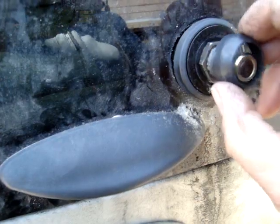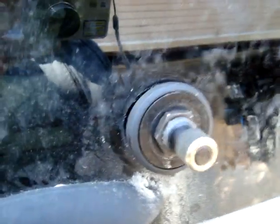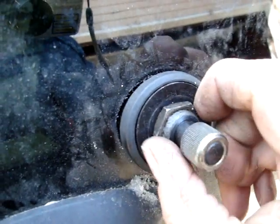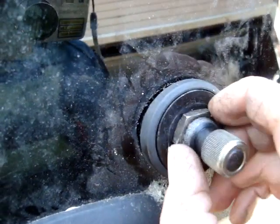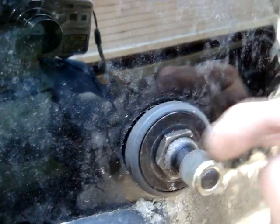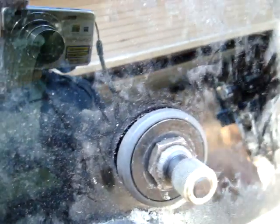Now, underneath that is this rubber piece here that comes off. Again, a little tougher than that, but there's your nut that you have to take off. So this is that $20 nut that I'm going to try to save. When I loosen mine now, I guess the casting is broken on mine, so the whole thing's just spinning. So I'm going to have to cut here and try to pull it out that way. The other nut that holds on here is different in different models, I think.